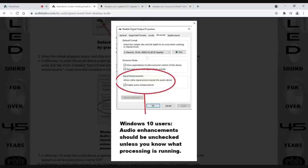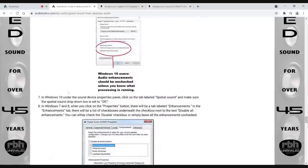At the default audio settings, make sure you're at least at 16-bit, 48 kHz — that's fine. If you're using Tidal high-res or J River with DSD files, pay attention to the default format. If you listen to SACD native, you sometimes have to switch back to PCM or you can get some external noises in your computer that are not pretty. At least set up for two-channel, 16-bit, 48 kHz, which is pretty sufficient in most cases.